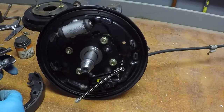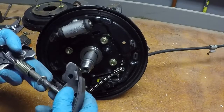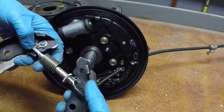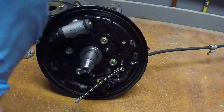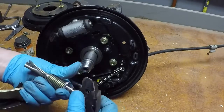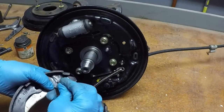Going back together — I'm going to put the spring in the back side first because it's a whole lot easier to get the spring on that way. You can see the spring is in there on both sides. Now I've got to get this guy back in — I just take it and twist it up a little bit and it drops in. Sometimes it comes out the other side — that happens. This is why nobody likes drum brakes; they're real fiddly and a real pain sometimes.